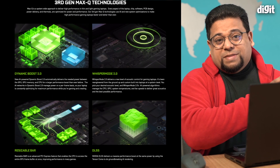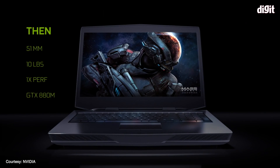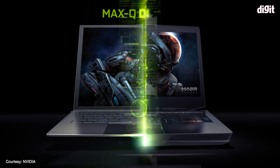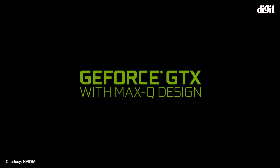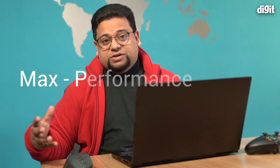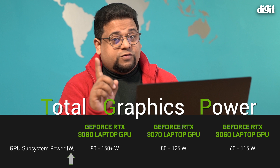Second, we've got to talk about what Max-Q and Max-P are. Max-Q was introduced by NVIDIA in 2017 as a way to designate that a GPU may be slightly underpowered but gives you great battery life — NVIDIA's way of balancing performance and battery life. OEMs started calling the full-fledged, fully-powered laptop GPUs Max-P, for Max-Performance. Max-P was never an official NVIDIA term, though it has been used by OEMs and NVIDIA reps. Up until now, Max-Q basically meant the same GPU except with a slightly lower TGP — Total Graphics Power — the watts drawn by the GPU to deliver frame rates, not to be confused with TDP.